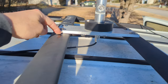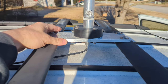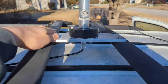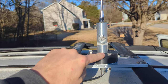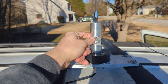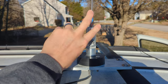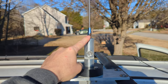I centered up the holes, made it laterally and horizontally as straight as I could. I piloted some holes, put in the bolts he sent with it, and then this hockey puck mount came with it, plus a tilt-over with a nut and bolt on each side so you can tighten or loosen as needed. If you really need the antenna to come down and don't want to take it off, you just unscrew this a little bit and the whole thing will tilt over.